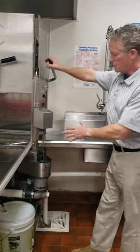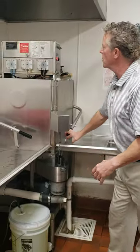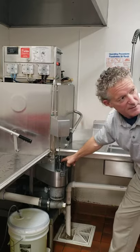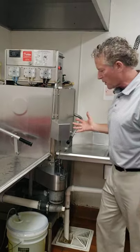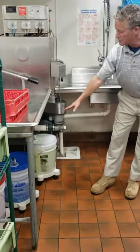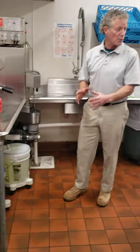Now, those are the first two things I check. When I shut this machine, it's going to start. You're going to notice that the first wheel that turns is your detergent bucket, and you'll see the detergent coming in right here. These are the three chemicals that operate the dish machine sanitation. The red chemical is the detergent and it's the first one that goes in. This is a red line going to the red detergent — and by the way, we dyed that detergent red.